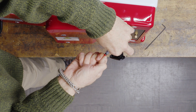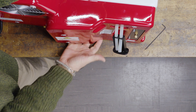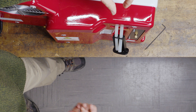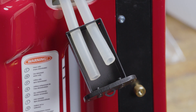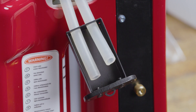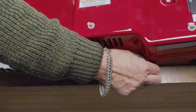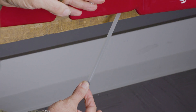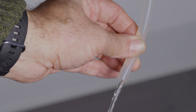The reason we're doing this part first is there's also another hose on the bottom of the machine. We're going to slide the machine over towards the edge of the table and pull that hose out. If we don't take these two caps out first, the water can't drain out. This machine is shipped with a shipping fluid — we need to drain that out. Then we'll put the bottom cap back in, fill it with water, and run the pump for about 10 minutes to circulate the water through. Now we've slid the machine to the edge of the table — we reach up under, pull this hose out until it stops. I found that if I pinch that hose just a little bit when I pull this cap out, it doesn't go in my shoe — it goes into a bucket.